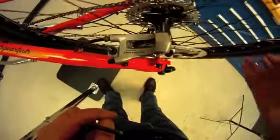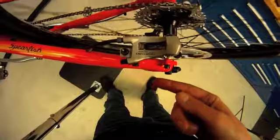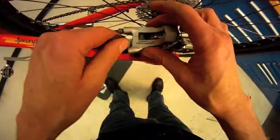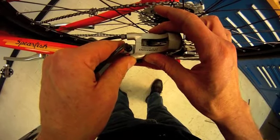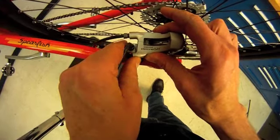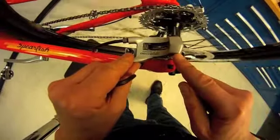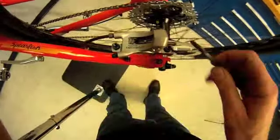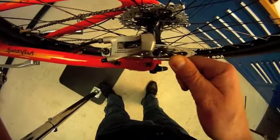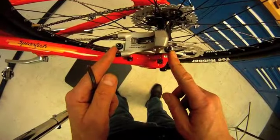It does not appear we have any rubbing. But looking at the background light, we can see very, very little light on the inside now. We're going to try and split this small, small difference. This is where it is important to have our rotors very straight and true. We're going to fully tighten — about seven to eight newton meters on these bolts. Best done with a torque wrench.